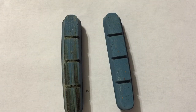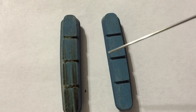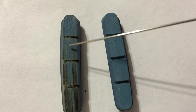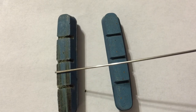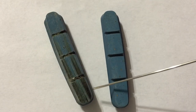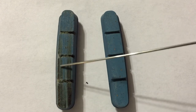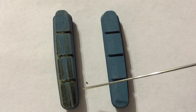One of the most overlooked and critical parts of maintaining your carbon wheels is the brake pads and the brake track on the wheel. The pad on the left has a black shiny area on it, which is a result of overheating the brake pad and not maintaining the brake track. This other pad here is a fresh pad that's been cleaned. One of the ways to maintain your brake pads is to regularly check them after every couple of rides to make sure you don't have this going on, as it will cause poor braking performance and can cause your wheels to squeal.